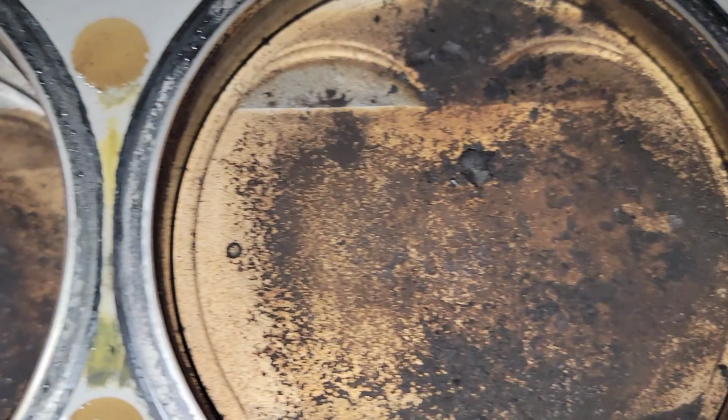All these runners are fairly clean and normal. Then these two, especially this one, has a bunch of oil and chunky oil at that in it. You can see the valves down there. Those look pretty good. Those as well. Something hanging off the side of the port in there, but that looks good. Other than that, I think that's some built-up carbon. A little oily on that left valve. That one looks pretty good.